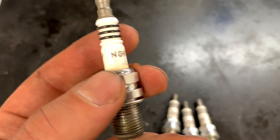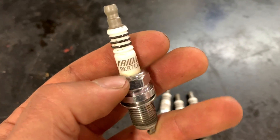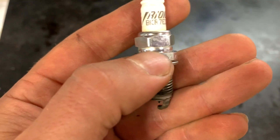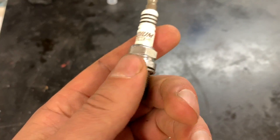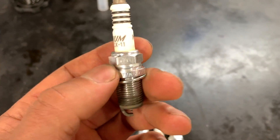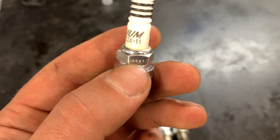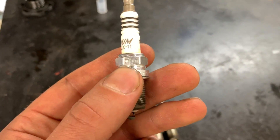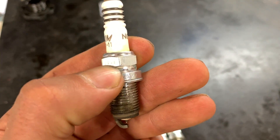You can also look at the white powder you see here — it turns yellow after use, but there should be some of this white powder where the parts meet. Look for any machining marks on the rounded part at the top or on the hex — if you see machining marks on either of those, that's an indication of a counterfeit. You can also look at what's kind of like their manufacturing or stock number. You can actually call this in to NGK and ask if it's a run number they're familiar with.